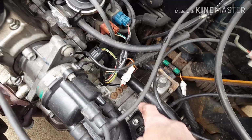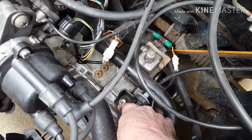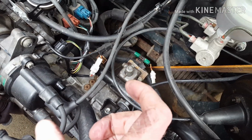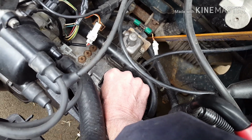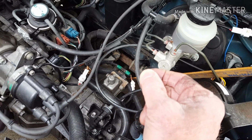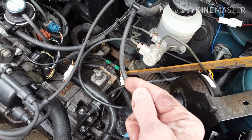wiped it off, and it's kind of a tight fit. You kind of have to turn it around and weasel it in there, and it scrapes a bit when it goes down in there. But I went in and then pulled it back out, and I measured 5 inches from when I put it down in there. I put my hand on the dipstick, so I knew the mark on the dipstick, and then pulled it back out, and it was 5 inches from the end of my fingers to where the dipstick was in the oil. So I knew that the level was good.